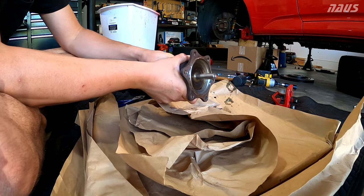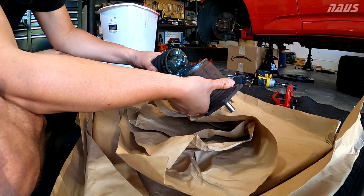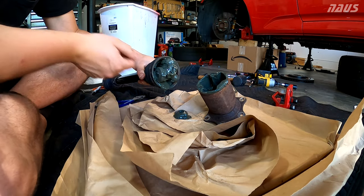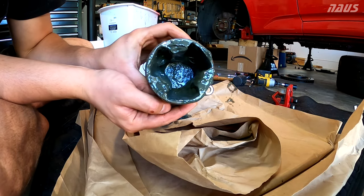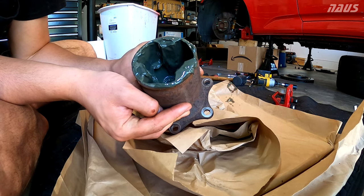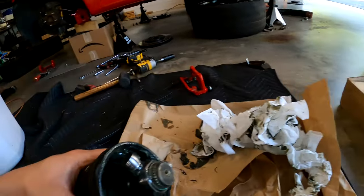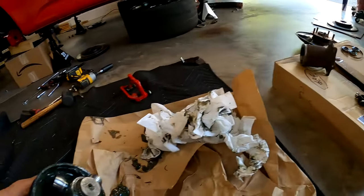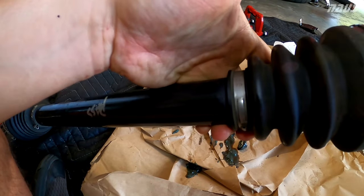You can see all the rust falling off this thing. When you take this apart, the bearings and everything fell into the rust particles, so I need to clean everything very thoroughly. This one looks a little more like cottage cheese on the inside — I may have had some moisture going on in this one. The driver's side did not look this contaminated, so I'm glad I'm pulling these apart. This is the passenger side and it will be swapped to the driver's side. Use a flathead screwdriver to work the clip up around 360 degrees, being careful not to damage it — it should stay nice and flat and tight. Once the clip is off, slide the tripod assembly straight out, then undo the inner boot clamp and slide the boot off.